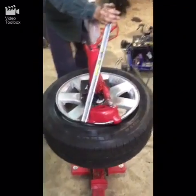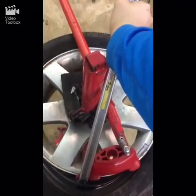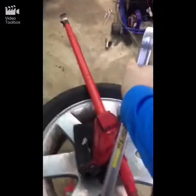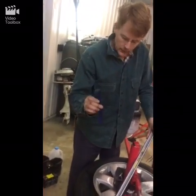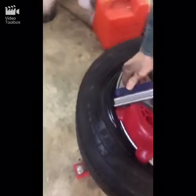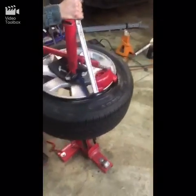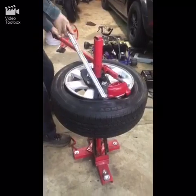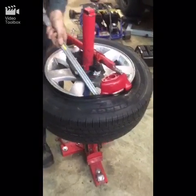You need something — a little bit of plastic or a little piece of wood — to stick right here so it will keep this tire from backing off the rim as you spin over. Now at this point you can start to move this over and you can get your tire iron out of the way. See if I can pop this over here. This is the spot where you have to be a little careful — you don't want it to ping off your rim.